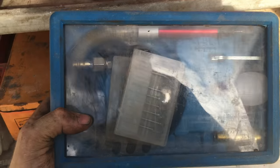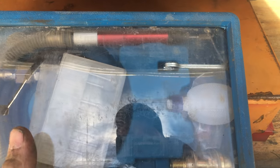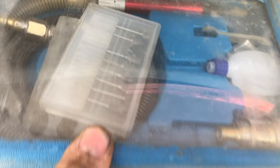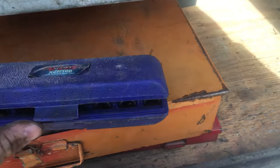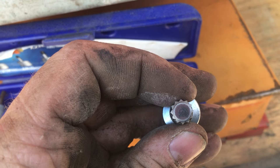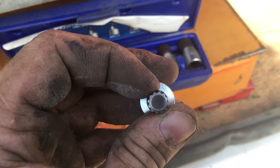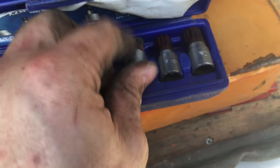This is a little pencil die grinder. These things are awesome — they've got little carbide bits. The number one thing I use this for is drilling out broken-off bolts. You can get really tiny carbide bits off eBay pretty cheap; the whole setup is about 15 bucks and it works really well. These are triple square bits — four millimeter and sixteen millimeter. They're called triple squares because they're not Torx; it's essentially three squares in one, like a 12-point Torx. Both swing-head bolts use that size — you can tell because those are the only two I've ever used.